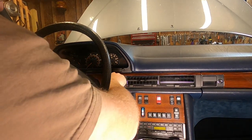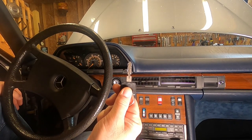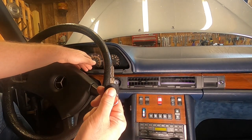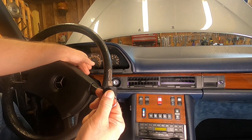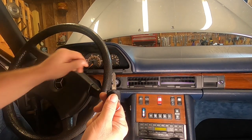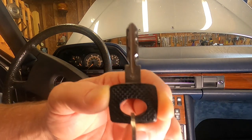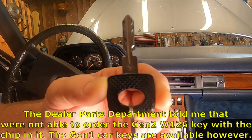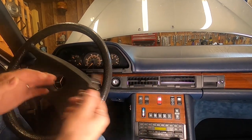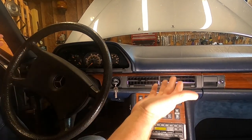What's my point in all this? It was the key. If you can believe that, it was the key. There's no misalignment of the steering lock, no misalignment of the steering column, no malfunction in the ignition switch, no malfunction in the lock cylinder. It's your key — they wear out. Go to the Mercedes dealership and buy a new key. I bet that fixes your sticking key problem.